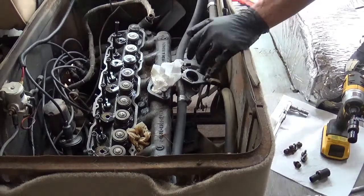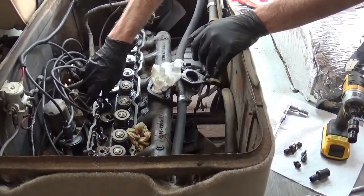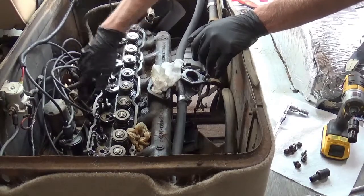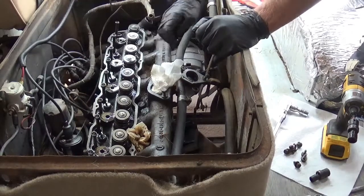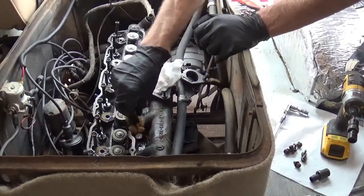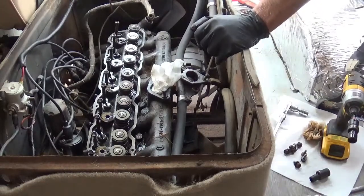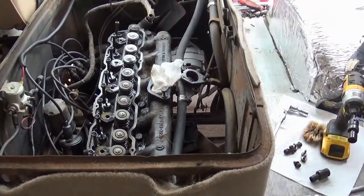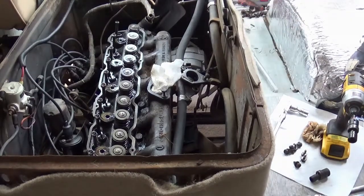Also safe to mention, before I actually pull the lifters out, I'm sorry, no, the push rods, I have a piece of cardboard with all the slots and holes, and I will end up keeping those lined up and numbered so they don't get confused with anything else. Those guys are slowly getting darker. These guys are torqued to 120, who knows what.